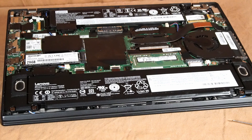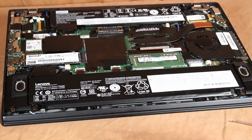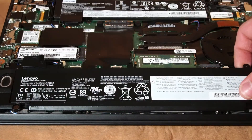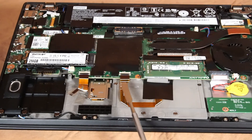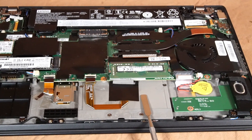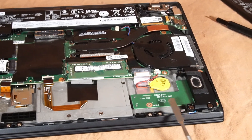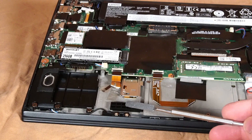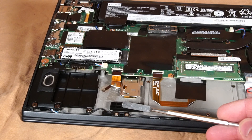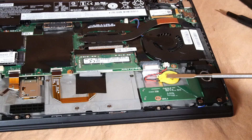For ease of access for things like replacing the touchpad, I'll quickly take this battery out to show where you can access. Here's the fingerprint reader, the area for the touchpad — which is just removing a few screws — and even over here the SD card reader. There's a little plastic piece as a placeholder for the smart card reader, and an additional plastic piece whose purpose I'm not sure of — maybe leave a comment below. And we also have the CMOS battery right here.